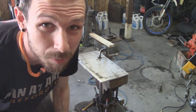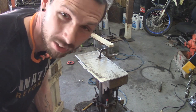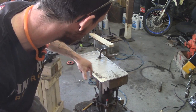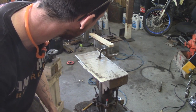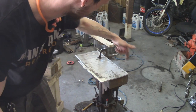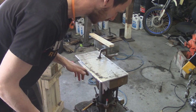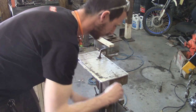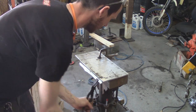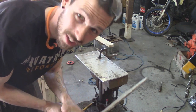I haven't worked a lot with aluminum — I don't really know the best way to cut it. It was not cutting very fast with the saw, so I used my plasma cutter to get the rough chunk cut and then trimmed it up with the sawzall. But the angle grinder seems to be doing the best job — it's just really hard on blades. We'll continue using that.